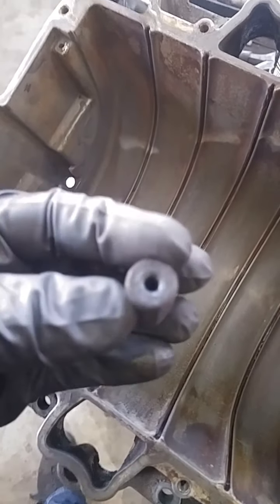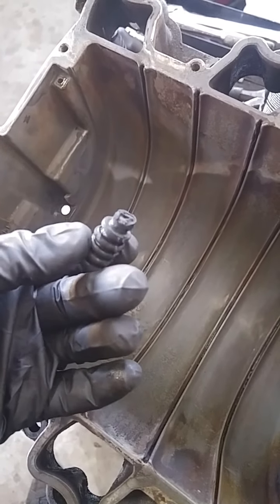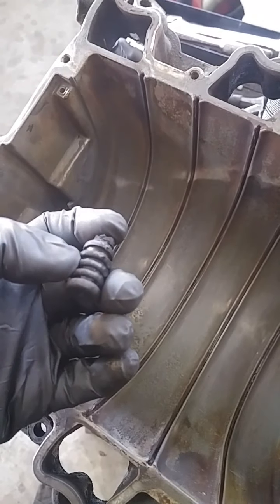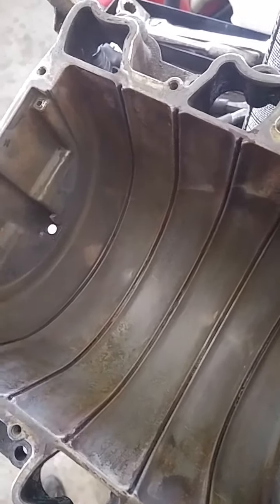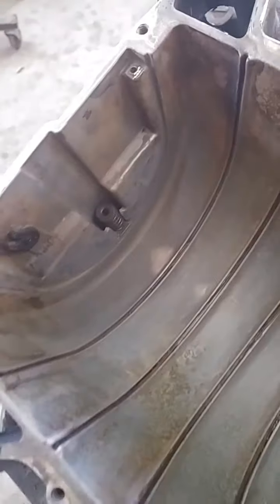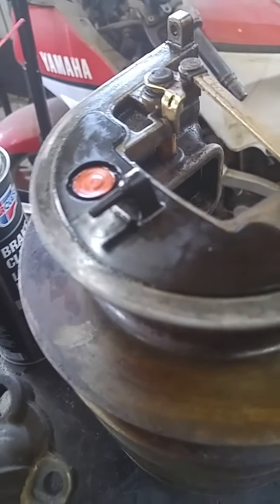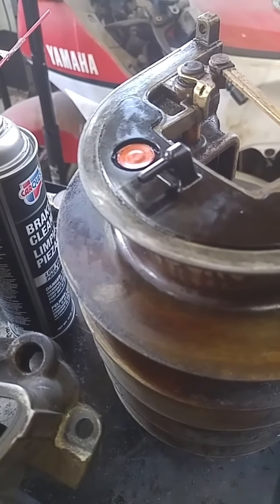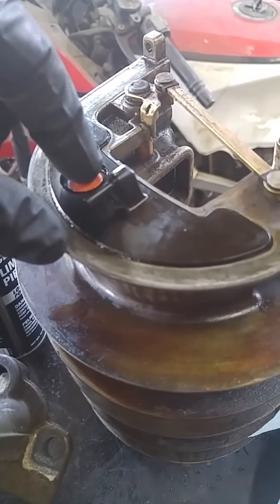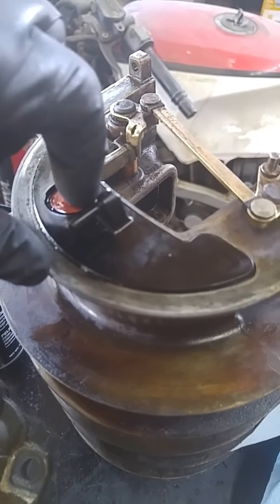Grommet, bushing, whatever the heck you want to call this thing. It's supposed to have a length of vacuum line come off the end here. And then basically it sits down inside here, and gets sandwiched in and provides a seal up against this little vacuum port on this tank right here. You can see there's like an old little carb diaphragm, a little one-way valve for that vacuum tank right there.